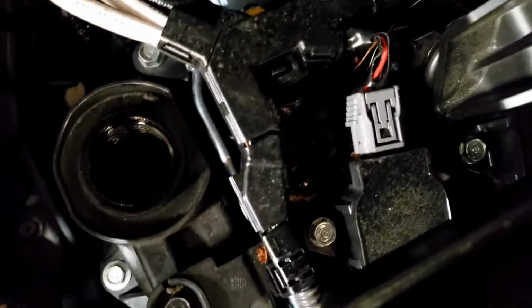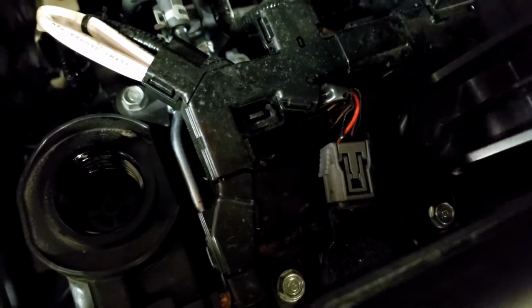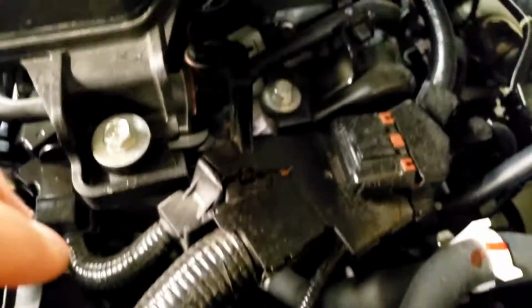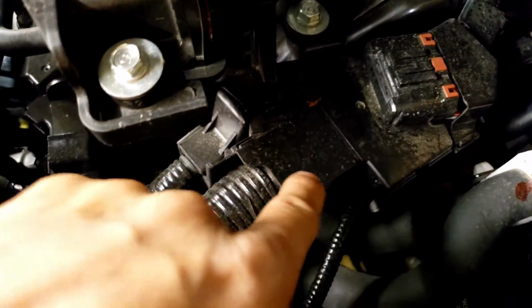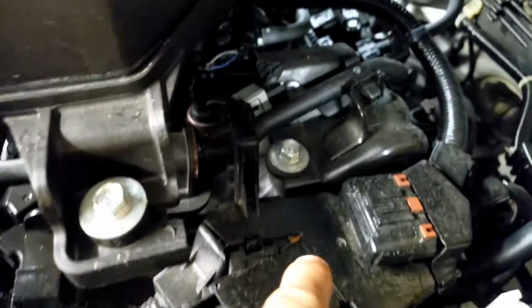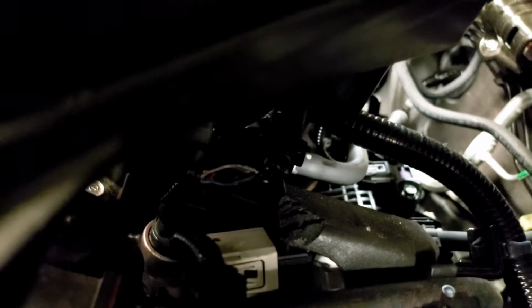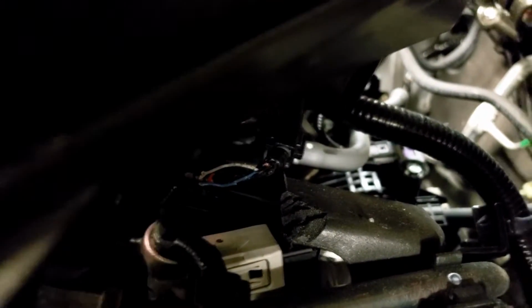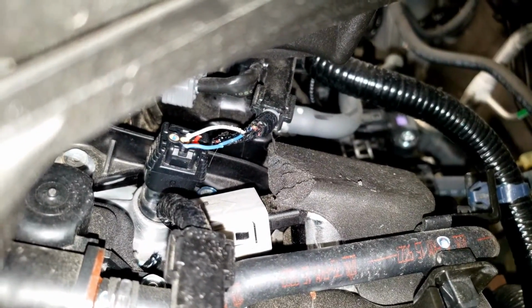I'm looking at the engine, I'm looking at that. It looks like some rodent droppings there, and partial insulation of the wiring is chewed. So I'm just following, investigating right now. Bunch of rodents there, and look over there, look what I found. Chewed wires. That is the camshaft sensor, and the wires are chewed.